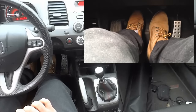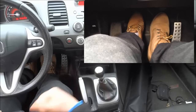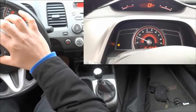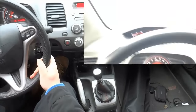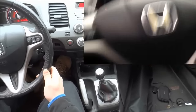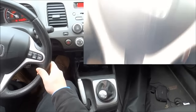Now we are going to look at how to shift through other gears as you are driving. We've gone over how to start the car in first gear. Now we're going to go over how to go into second, third, fourth gear and so forth. So we're going to start rolling again: clutch goes in with the left foot, gear selector goes into first gear, take my foot off the brake, push the gas and bring the car to about 1500 RPMs, then slowly release the clutch pedal. Now we're rolling. When we're ready to shift — the RPMs are different for each car, but for this car I like to switch at about 3500 to 4000. I press the clutch in, take my foot off the gas, put the gear selector into second gear, push the gas just a little bit, and release the clutch slowly. Now we're rolling in second gear.